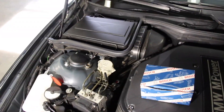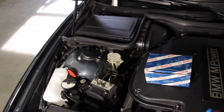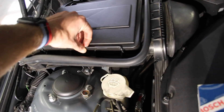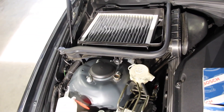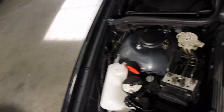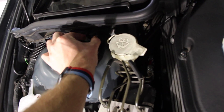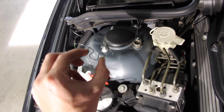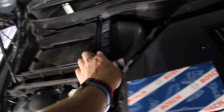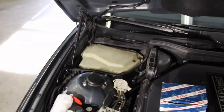We do need to first remove the upper cabin air filter box. There's a little lid here with a little clip — you release that, take the lid off, and now is a good time to clean and replace filters if necessary. Then there's a little clip at the bottom that you wriggle off. Then there's a piece of trim that lifts right up — the weather stripping — with three tabs that come off. You can take the box and wiggle it up and out of the way.